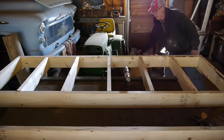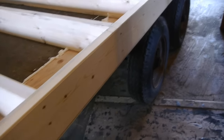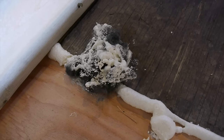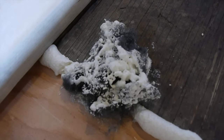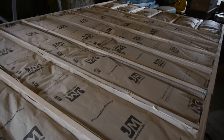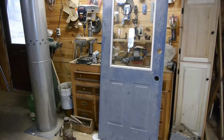It hangs off the back about 16 inches, and on the side too. Then I took plywood and screwed it to the bottom to seal that up. I wanted a bottom on the whole trailer. That's steel wool — it plugs up the holes so the mice won't come in. Then I used R19 insulation, so we've got a nice insulated floor for the cabin.